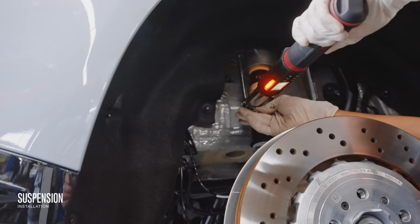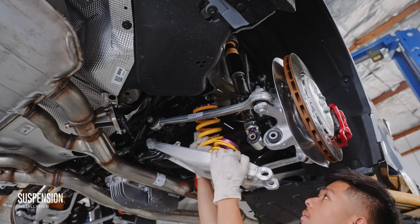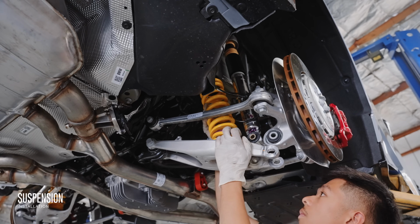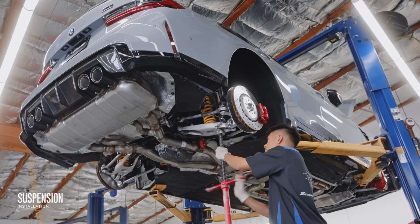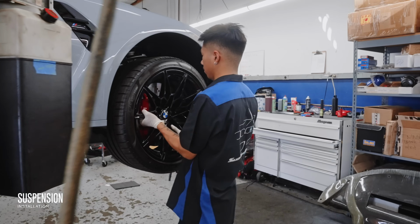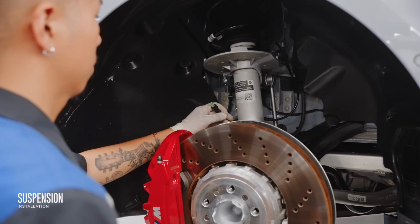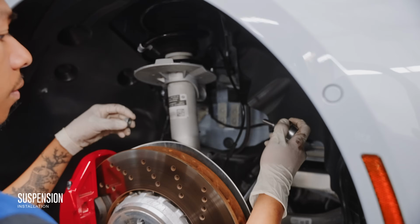It's honestly a shame that BMW went with such a soft suspension for their competition models. You'd think with a slogan of the ultimate driving machine that they'd go with a more aggressive setup for their premium trim M model. Although it is a step up from the regular 3 Series suspension, as well as lighter with its aluminum composition, we feel that the trade-off in strength by going to a stainless steel strut is worth the additional weight gained to support a more aggressive driving style. However, for your peace of mind, if anything were to happen, KW backs the V3s with a lifetime warranty.